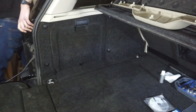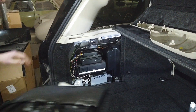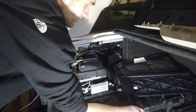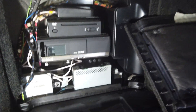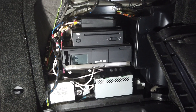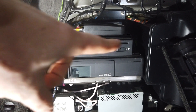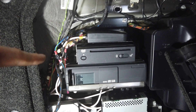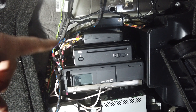You obviously got to go to the back of your car, and it lives in this corner here. In the back you've got this little - quite easy, you don't need any tools - just pull that little carpet side panel out, and then in there we've got what looks like a 1980s hi-fi stack system. We've got your phone module on the top, and then you've got this DVD player - this is where the map data is stored. It's stored on a DVD, not on a hard disk. And then we've got the CD multi-changer.